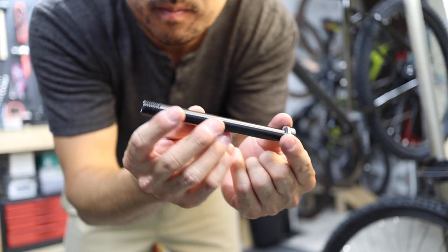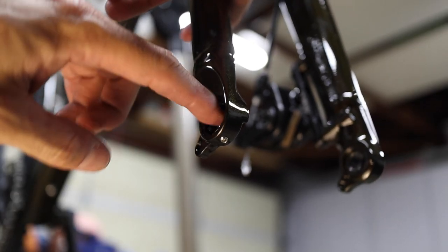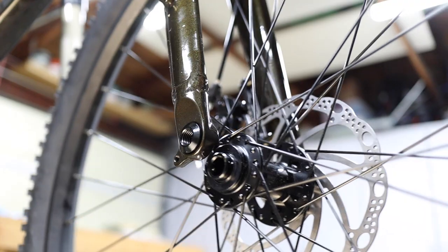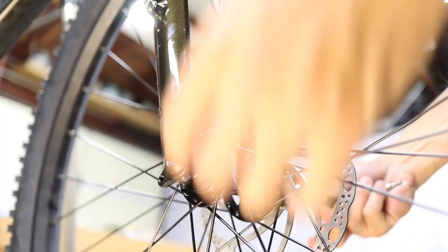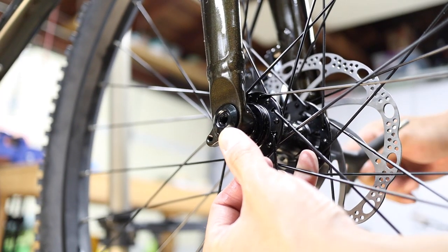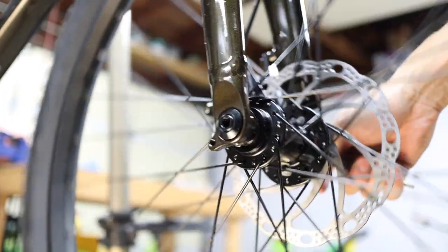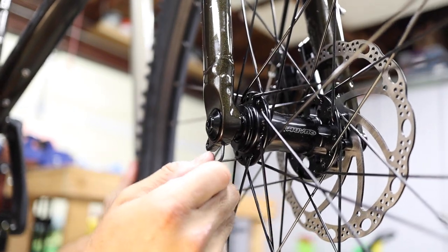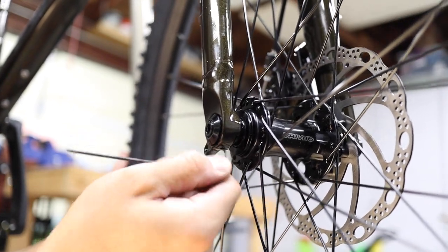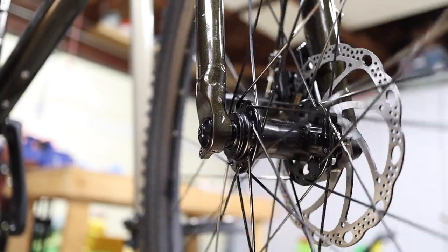Next, find the shorter front axle and the threaded axle nut. Lightly grease the interface and insert the nut into the right side of the fork dropout. Slide the front wheel in the fork, making sure the disc rotor slides between the two brake pads, and slide the lightly greased through axle in from the non-drive side and tighten it down with a 6mm Allen, again aiming for 9 to 13 newton meters of torque. Secure the nut in the fork dropout by tightening the 2mm grub screw in the bottom of the dropout — just ensure that it won't back out on its own.